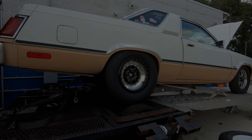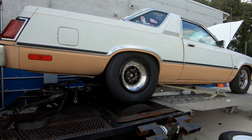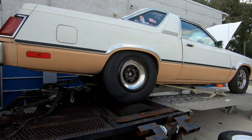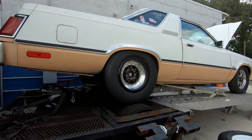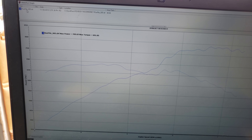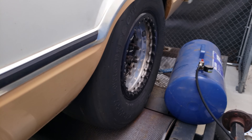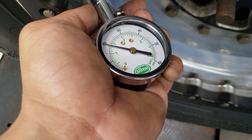That is a wavy, wavy graph, but let's show you what we got. The graph looked really bumpy, right? Really bumpy, and it showed about 789 horsepower, which isn't that good. I think a couple of things are happening - I think the tire pressure is too low, because according to the math we're at about 820 rear wheel horsepower mod nationals, and we're only at 20 psi on the tire.